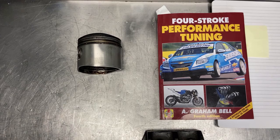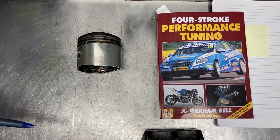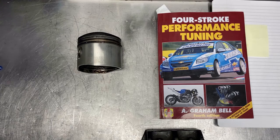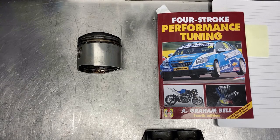So the top ring groove seems to be the weak point of this engine. The question is: what caused it and what can we do to prevent this? I went to my local machine shop and they said it was due to high revving the engine. However, this was a torquey engine — I always shifted at 6000 rpm, sometimes 6500 rpm. Also, the second ring does the same rpm with no problem, so this probably isn't the whole story.